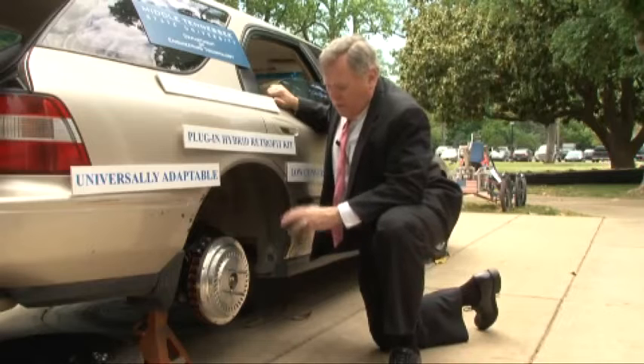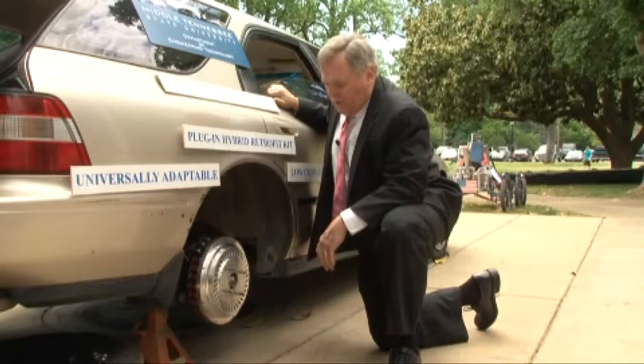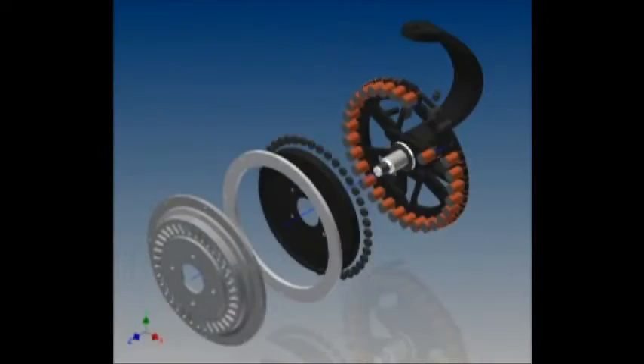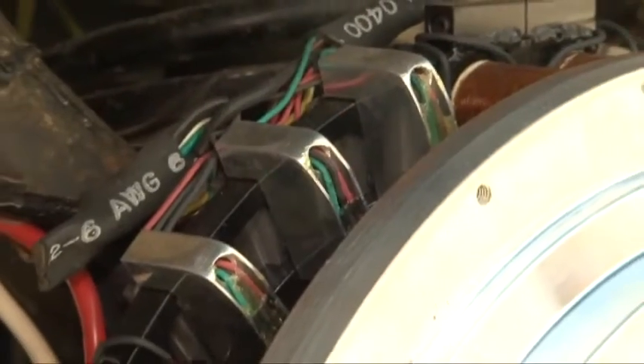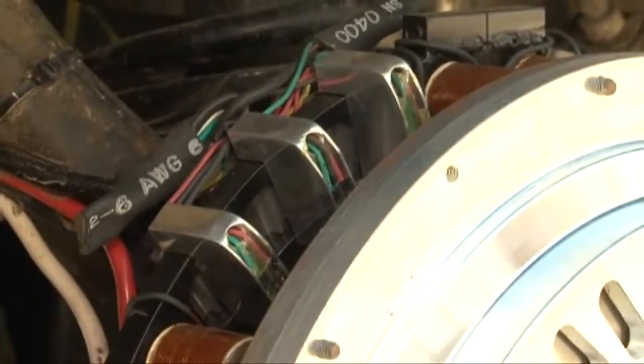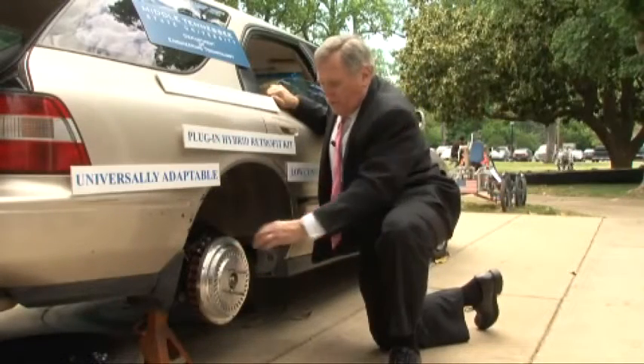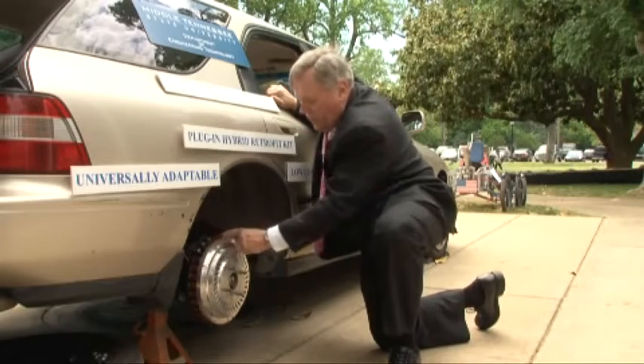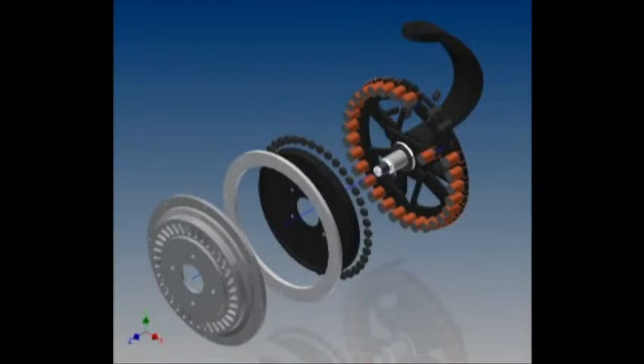In this application, what we have done is taken the suspension components on this car — a '94 Honda — and packaged the stator magnets all the way around the back side of the rotor. These are electromagnets that switch on and off at the proper intervals as controlled by three hall-effect sensors. This is a three-phase DC brushless motor for maximum torque. The permanent magnets are on the back side of this rotor — an array of 40 permanent magnets — and when the system is actuated, this turns into a DC brushless motor with 200 foot-pounds of torque.